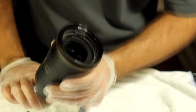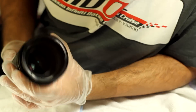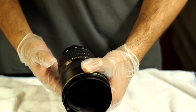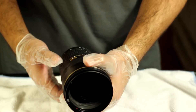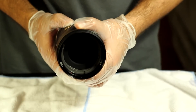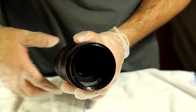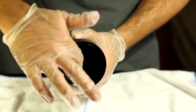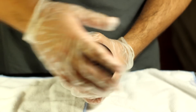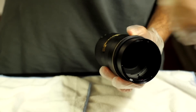Let's take a look. As you can see when zooming to 70, you might have heard a metal rubbing against metal — like a screeching sound. Going back to 24, still a little tight. If you look closely around here — not in the grooves, but around here — there are light scratches. So what I'm going to do is add some white lithium grease, very little of it, and just smooth it around here.